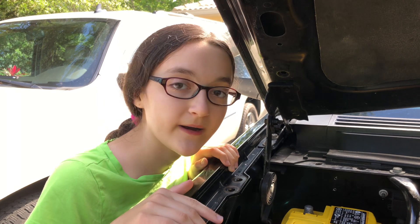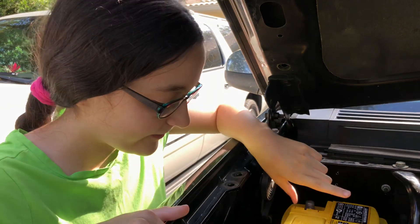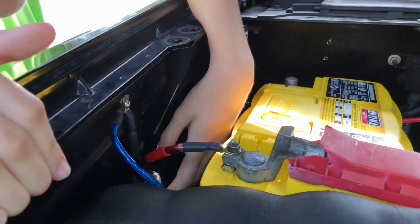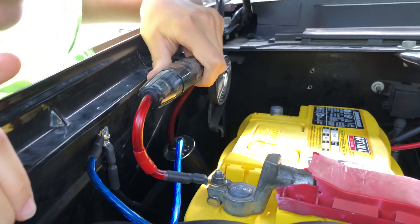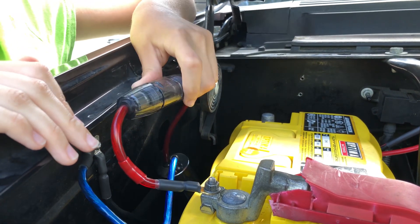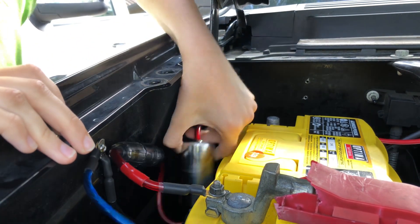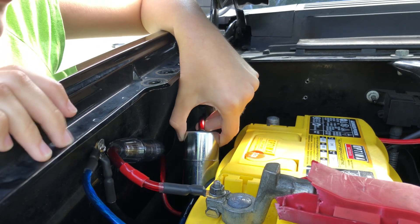Today we've been working on our ham radio setup in the car and we're about done with the electrical system. The battery is not hooked up right now so we're good, but we have directly connected right next to it a 40-amp fuse, and that goes to a noise filter because we could hear the alternator before.